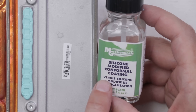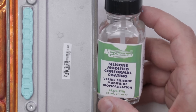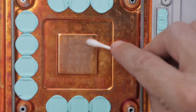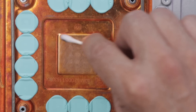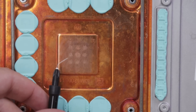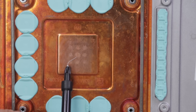This is what I'm using for the conformal coating — I'll link that in an Amazon affiliate link in the description. While the APU is drying, I'm going to prep the heat sink and get the liquid metal applied to it. It is important to note that liquid metal will corrode aluminum, so you only use it on copper heat sinks.